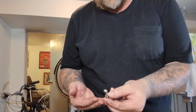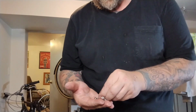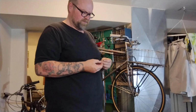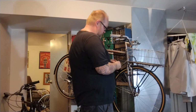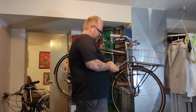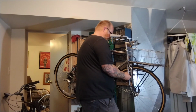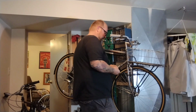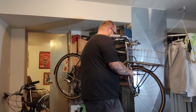So I found a couple more bolts. They even match the ones I just used in that clamp-on hardware. I got 4 little washers, got some nuts. You don't have to make all your hardware match, but it's a lot cooler if you do. Put washers underneath everything. Guys skip that all the time. Things won't bind, you get accurate torques, things will actually tighten down instead of just strip or bind. Make you think it's tight and come loose later, so it wasn't actually tight, it was just all bound up.